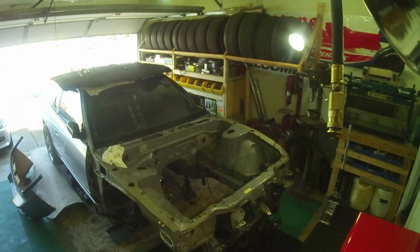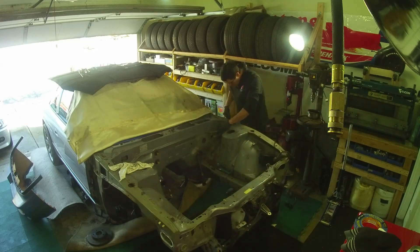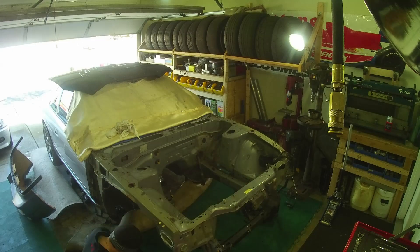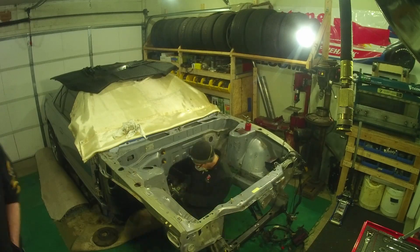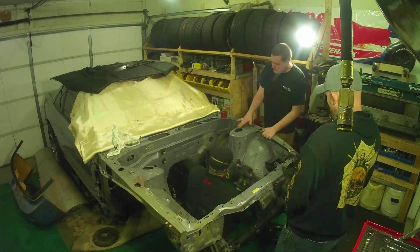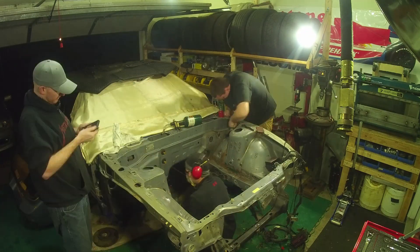At this point I've pulled the main body harness as far as I could out of the car, because to get it through the left front corner you have to pull apart the relay and fuse boxes, which I didn't want to do — some of the plastic is pretty brittle and I didn't want a chance of breaking anything. Me, Glenn and Brian were just removing all the seam sealer, cleaning up the seams that are going to get stitch welded, and to figure out where the rust ends and the good metal begins.